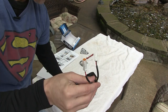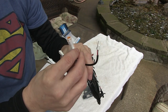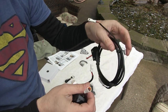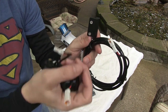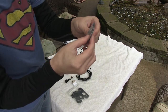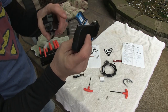There are two wires on the bottom of this. The one that connects to this cable you'll know because it's male/female — they go together. This is the wire you'd use for a dirt bike. The other wire is for a battery, so if you don't have a battery on your bike you're never going to use that wire — you'll just zip tie it off. This is the sensor; this is what goes onto your brake caliper on your front wheel. The magnet passes through this and this is what makes the unit work and turns it on. It also came with a bling sticker, which is super important.